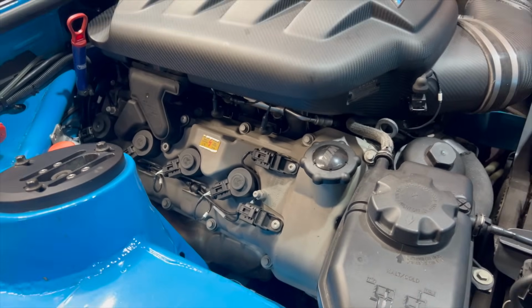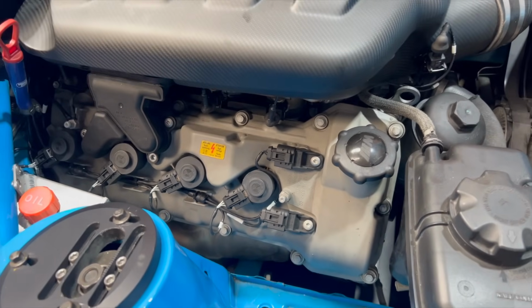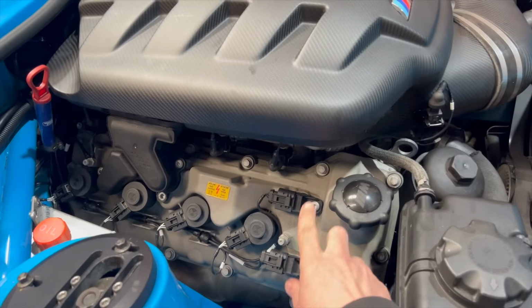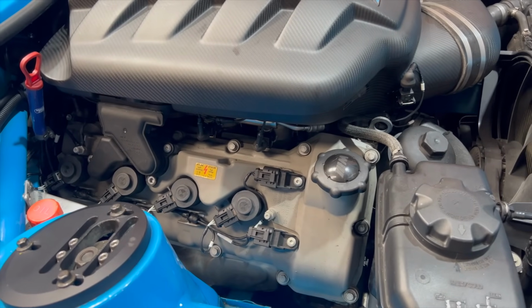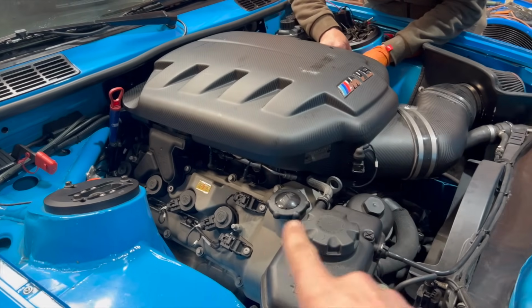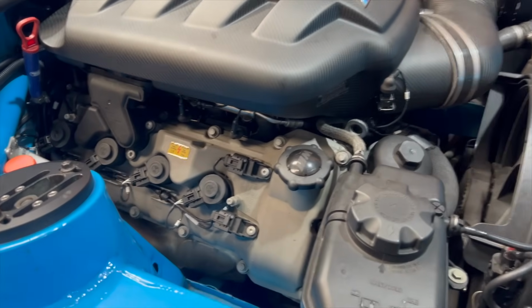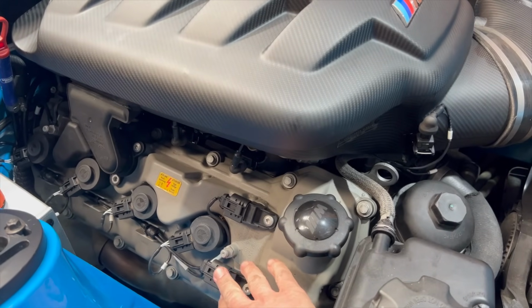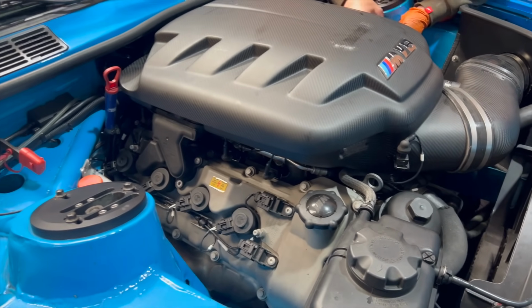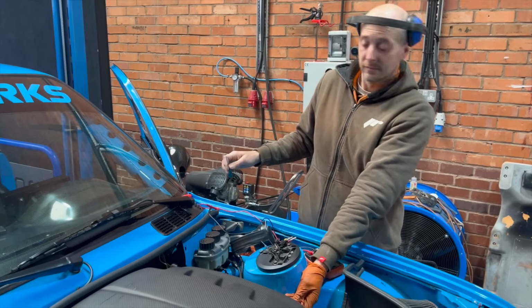By the process of elimination, with some help from Matt at Level Motorsport. Matt has wired these cam sensors as per the internet. But Carl at Emerald has just saved the day through Craig next door to us, who's had an Emerald running one of these and done loads of work getting the Vanos working on that with his Emerald ECU. He's just told us the pins for these, and we just need to flip-flop two of the three. We just tested one, it's successful. Doing the other three now, and hopefully we should be able to get this thing running.